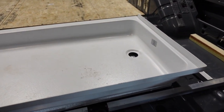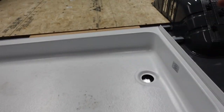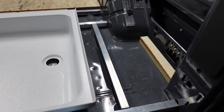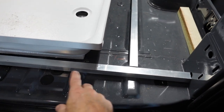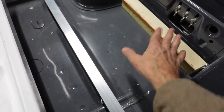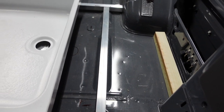Here's where the shower is going to go. We'll actually have a cabinet that will cover part of this - this part will be the toilet and will slide out over the opening, and that's how we'll end up accessing the toilet. We need to put in the subfloor here which is one-inch square tube aluminum, and then cut down some treated two by four to make it level. This is all going to get bonded with the 3M5200 to the floor.